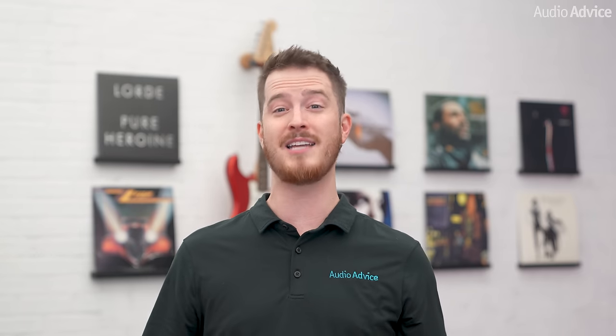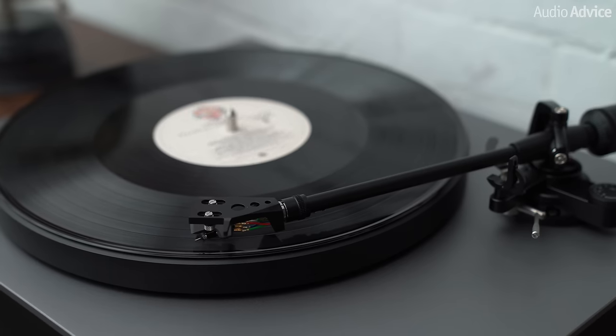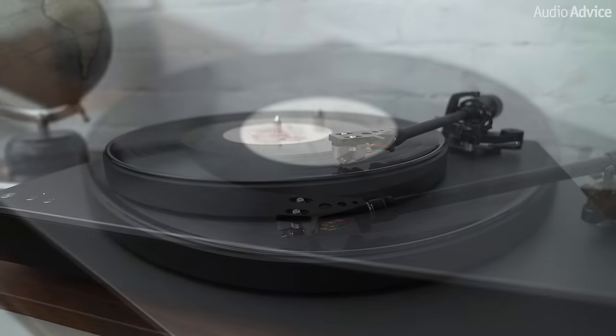One thing that has been very appealing to people listening to vinyl is the way it seems to draw you into the music. At Audio Advice, we feel part of this is due to the fact that a great turntable keeps the pitch of the music just perfect. CD players over the years have gone to great lengths with all kinds of clocking technology to try and get those digits to come out at precisely the same pitch as they went in, and many audiophiles might argue that they never did fully get it right. So how does a turntable affect this? The answer is consistency of speed. A direct drive turntable gets up to speed quickly and holds its speed over time very well, but what keeps it going at the proper speed? Direct drive turntables require a lot of circuitry that is constantly looking at the speed of the motor and making adjustments to keep the speed from changing. The constant correcting of speed manifests itself as very tiny changes in speed that are not really measurable, but our ears seem to be able to discern. For this reason, we feel you are just drawn into the music more on a better belt drive turntable — but belt drive alone is not the end-all be-all.